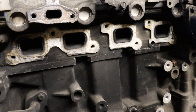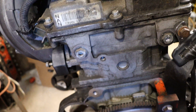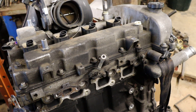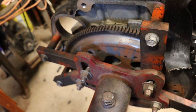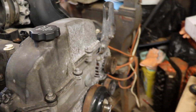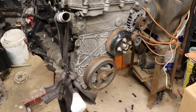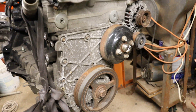I also noticed that the exhaust manifold flange is very similar to the six cylinder — the six cylinder just has two extra cylinders on the back. So if I buy a six cylinder flange I should be able to just snip off the back portion and it should line right up. You guys probably shouldn't even have to ask — this will be a turbocharged engine. We're definitely not fans of running these naturally aspirated unless you get the compression up and throw big nasty cams in it. Another difference I notice is the flex plate looks significantly different.